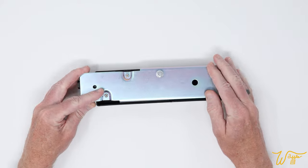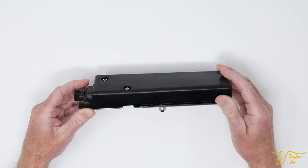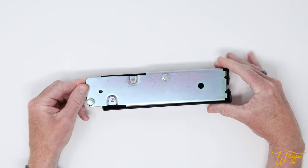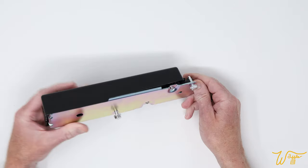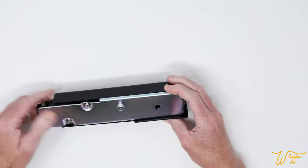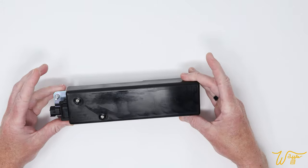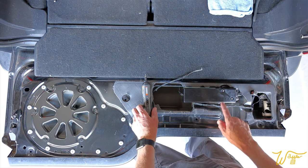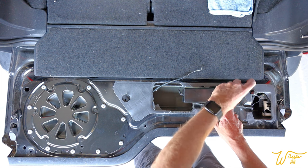Nice hardy stamped metal back with the plastic cover, and it comes with the replacement bolts to mount it onto the tailgate. Right here we have the plug. It looks like over here we're going to need to remove this plastic cover to be able to get the cable in there. Let's take it out to the car and do a function test. We've got our new actuator lined up ready for a test. These two screws here are T15, so let's remove those.